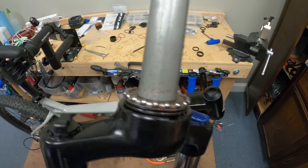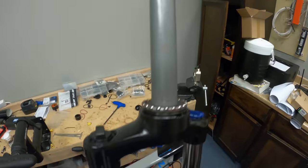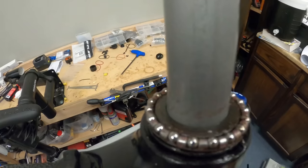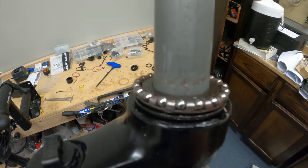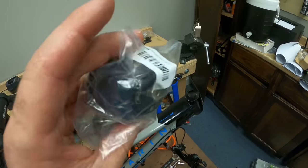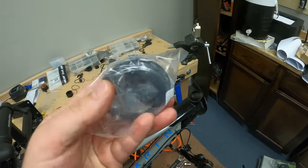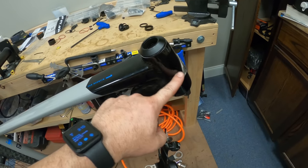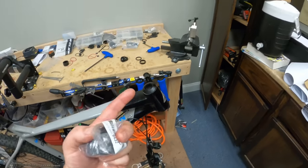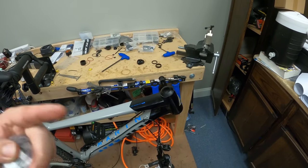So what you'll find on the San Quentin 1 is that even though it has a tapered head tube, it's actually using a straight steer fork with a crown race adapter. Since I'm putting a tapered fork on, this won't work. So here's a new sealed bearing headset I'm going to put in the San Quentin. If you have a San Quentin 1 and you're doing this upgrade, link below for the type of headset you'll need. Also, if you have a straight steer head tube, there are adapters that allow you to use a tapered bottom cup so you can use a tapered fork on a straight steer — link below.